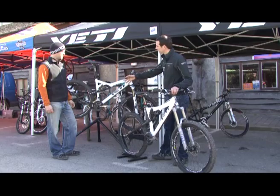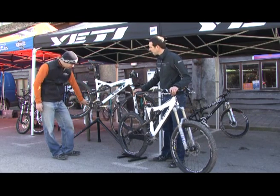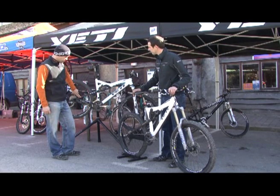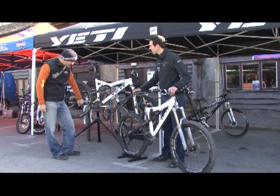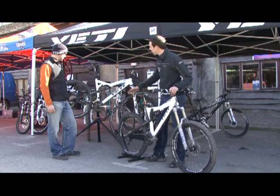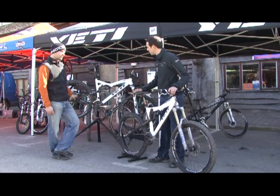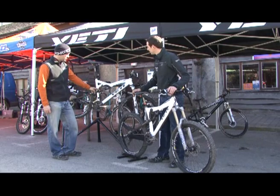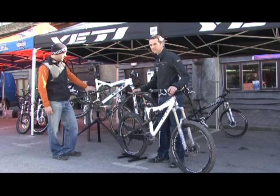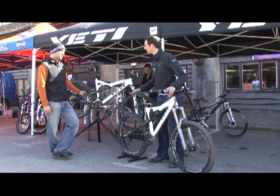And you're sticking with the carbon rear triangle on there? It's a lot beefier, deeper section carbon rear on the new ASR5. So it's stiffer, mainly because of this big deeper section down here, but still retaining plenty of mud clearance. And it looks like you've beefed this dog bone linkage in the centre. That's been remachined and tightened up. Nicely machined and finished, but it still retains the dog bone link and that classic Yeti standover height and style. And it comes supplied with an RP23.